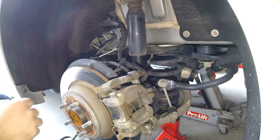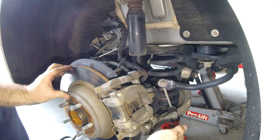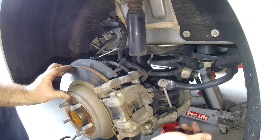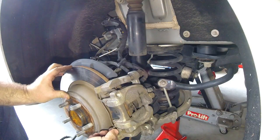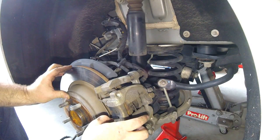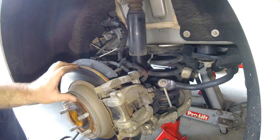For those not familiar with brake terms, there are a few key components. You've got the rotor - that's the round part - and then you've got the caliper. This rear caliper is very different from your front calipers because it integrates both your anti-lock brake system and your emergency brake in one unit. Be a little more careful back here since there's more that you can damage. You can see the pads and a retaining clip that prevents vibration, plus a spring clip we'll cover once it's apart.